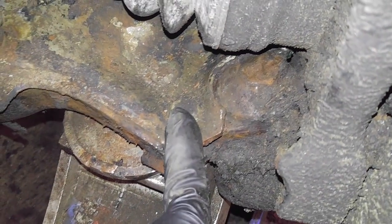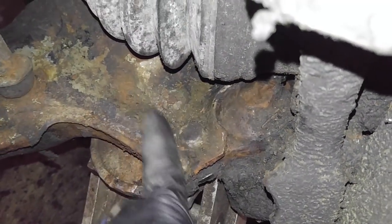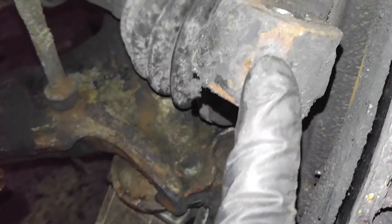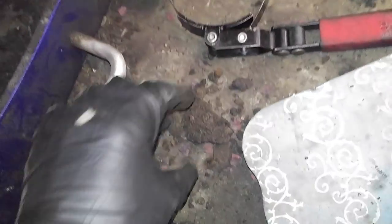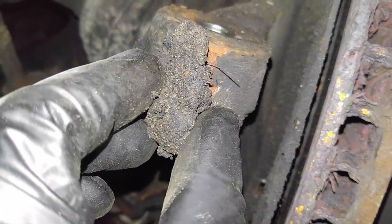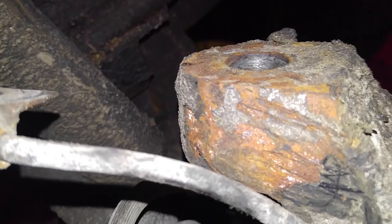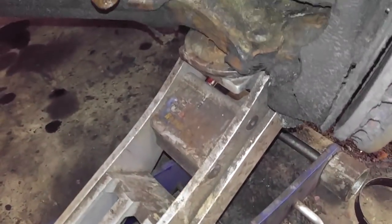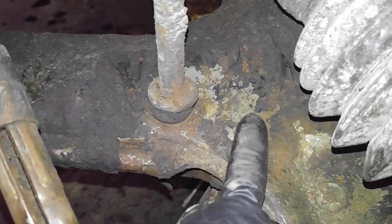You grind off those rivets, and they pounded those things in with some big machine because they expand the lower control arm. What's interesting, though, is I had this rust-proofed when I took off the clumps of fluid film, and it was thick. There was moisture underneath it, just like rubberized undercoating. It was wet underneath. Same thing on the top. Yep, that salt's brutal. It wants to go everywhere. So what's the solution? Scrape off all the fluid film and then apply a thin coat every year?